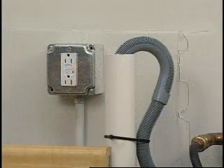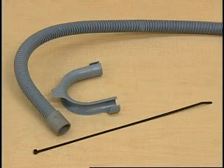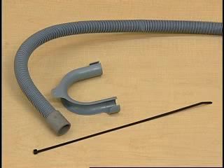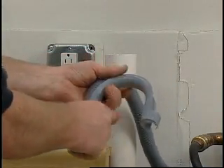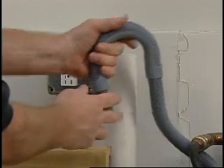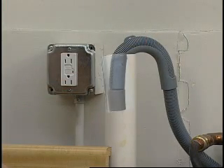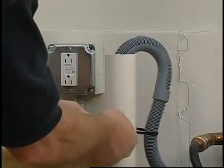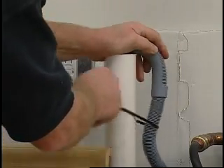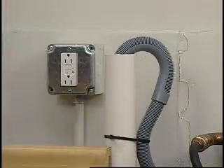It is very important that the drain hose be installed correctly to avoid water leakage and floor damage. Many washers are shipped with a hose, drain hose hook, and a tie-down strap. The drain hose needs to be installed into the drain hose hook, and the hook should be placed into the standpipe. No more than eight inches of drain hose should be extended into the drainpipe. To prevent the hose from coming out of the drain during pump-out, a tie-down strap should be used to secure the hose, regardless of standpipe or laundry tub.